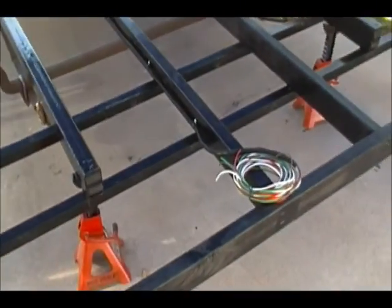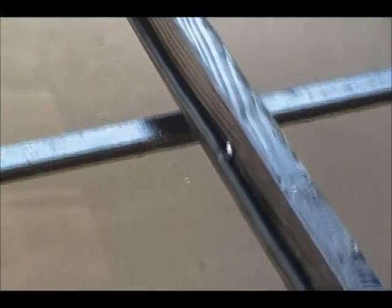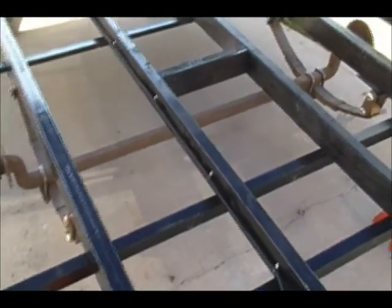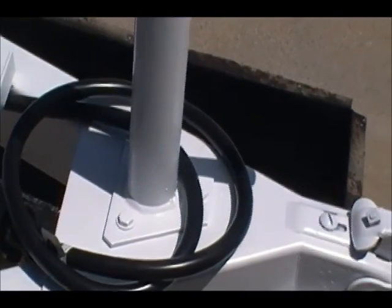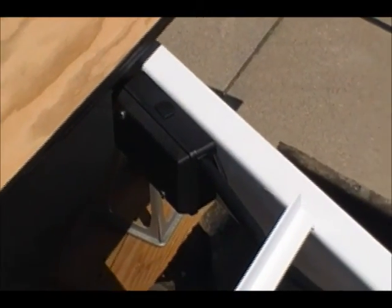I also put in the new wiring loom. You can see the loom going right along the side of that floor joist, goes all the way to the front. There's the box, and out of the box comes the seven-wire with seven-pin connector, which would be connected to the tow vehicle — whatever it may be: van, truck, car, or other.